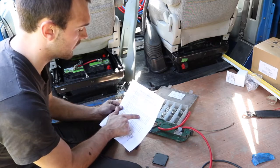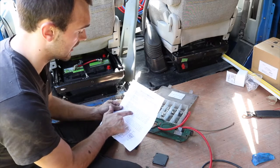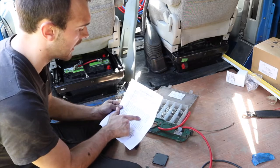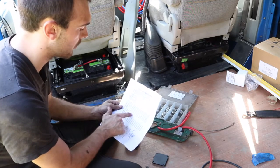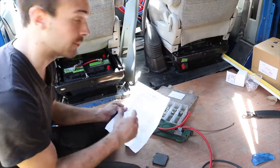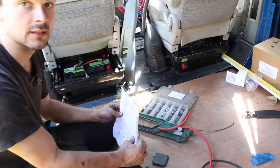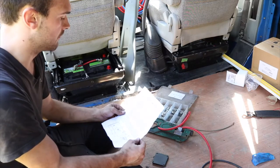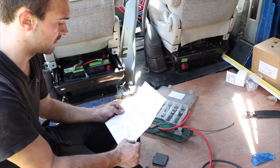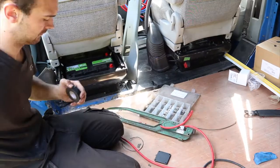When the voltage drops below 12.8 volts, for example when the engine is stopped, the VSR disengages, separating the batteries. This system eliminates the possibility of draining the wrong battery and protects sensitive electronic equipment powered from the house battery from harmful startup spikes. So when you start up the van in the morning or whatever, there's like a spike for the alternator or for the starter, which could cause issues. So it's basically just a safety feature in between, which you have to put there. So that's just a quick kind of thing. So now let's continue.